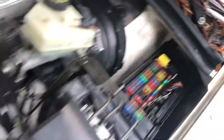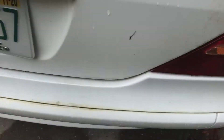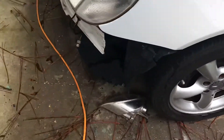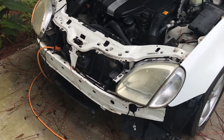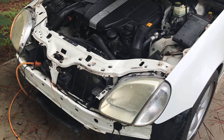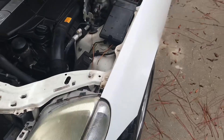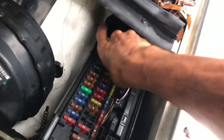So if I put this in here, you'll notice that this light is staying on, this light is staying on, and this light is staying on. But if I press the unlock button, you'll see they blink — so the switch is working. Everything in the system is working, but I got the wrong relay. I'm going to pull this back out to show you what I'm talking about.